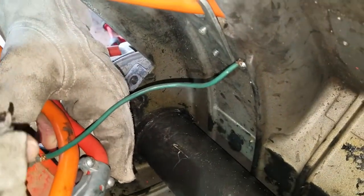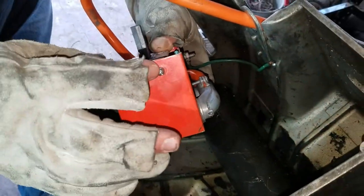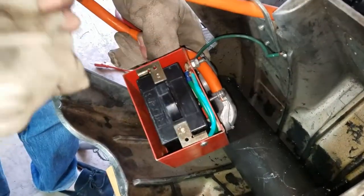Make sure you've got a ground connected. You might not have one on your machine, but you need to connect this metal box to the casing just to keep from getting shocked. Now to get the switch out, you've got to take the screws out on the ends — one, two. Once you pull those out, the switch will slide out and we can start working on it.